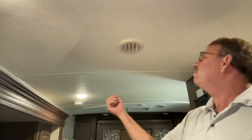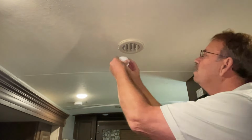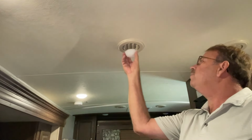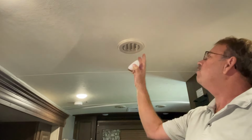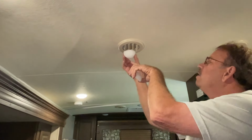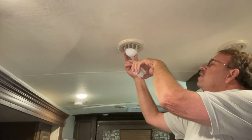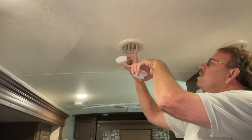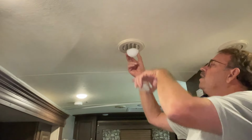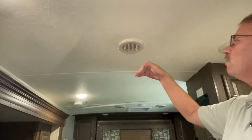I removed this here, and inside the duct, I took a foam ball, cut it in half, stuck it up in there, and then put this back on. When this was stuck up in there, there was probably a distance in the ducting about like that far from the top of the vent fins here. Then I ran the test, and it actually made the airflow worse here.